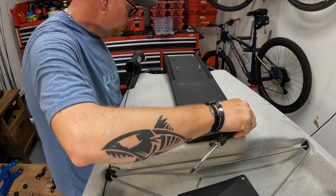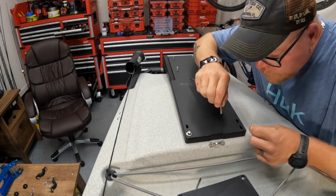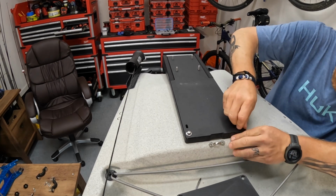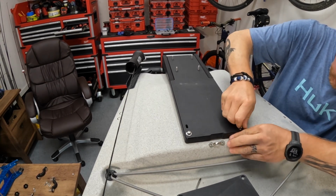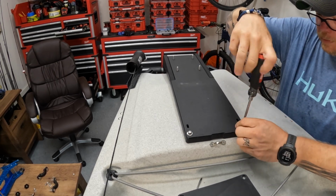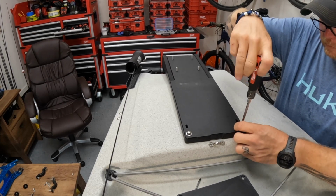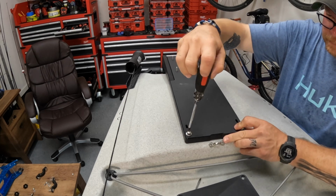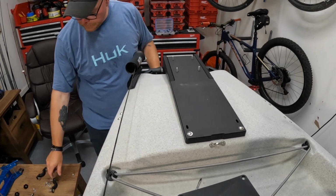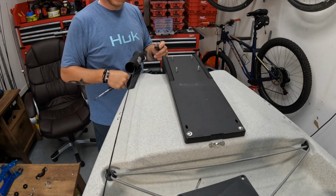And like I was saying before I dropped the screws 15 times, do not use a drill to do this. Only use a screwdriver, because they're only brass inserts in a piece of rotomolded plastic. If you overtighten this, you're going to break these, and then you're going to have to try to use JB Weld or something to hold it in place, or you can strip these out very easily too. So you just want to snug these up. That's it. It's more of just a guide to hold those on. So our next part is we've got to take the U-brackets, slide these around the handle and tighten up that hardware next.